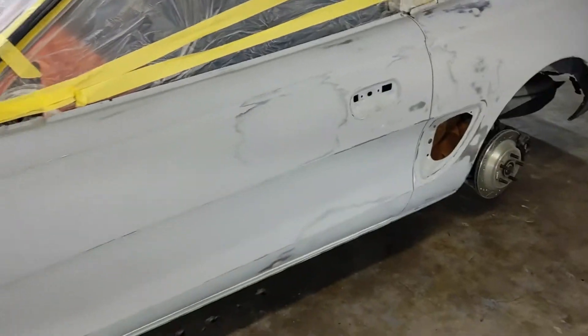A lot of guys would have stopped, wet sanded the epoxy primer, then done base coat. My base coat is single stage so it's fairly cheap - it's non-metallic. I was like, what am I gonna spend 40 bucks on? I got a gallon of the stuff. I shot about 10 ounces - 10 ounces covered the entire body of the car really well. If it had something good to stick to, if the sealer coat and the substrate underneath were good, it wouldn't look so dry. I would have gone back over it and shot another thick layer of the single stage stuff.